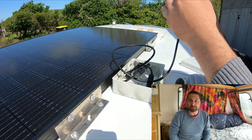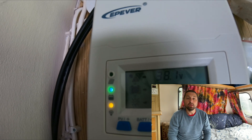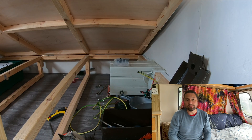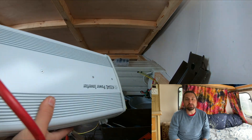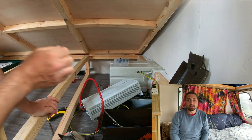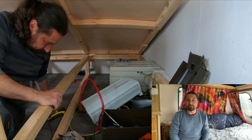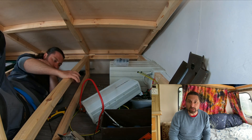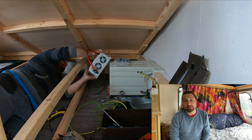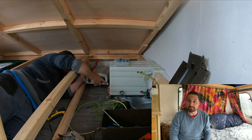Now connected, you can see the flashing green light at the top of the unit telling me that it was sending charge to the battery. We'd been given a used inverter which we are enormously grateful for given their cost. As the units themselves are fairly heavy I thought that I would install it as far forward in our caravan as possible to offset the weight of the panel at the rear. I managed to drill another hole in the battery box for the cables to pass through and connected the inverter up to the battery.